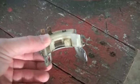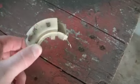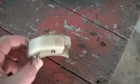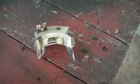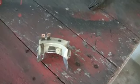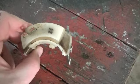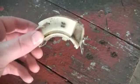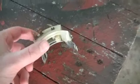These are unique to the 3-speed column shift transmissions, automatic transmissions, and the 4-speed floor shifted transmissions have those reverse light switches actually mounted to the transmission. So I'll go and order up a new one of these, and hopefully that'll work.